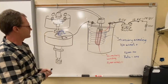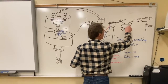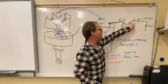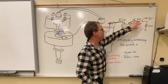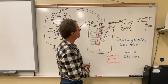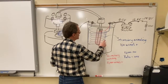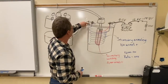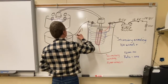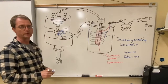When we turn the key on in our car, we send power from the battery through the ignition switch. On older cars, we had a special resistor called a ballast resistor that brought the voltage down from 12.6–14.8 volts — the range when the car was running — stepping it down to 9.5 volts. It would come into what we call a primary coil inside of the ignition coil and run through that primary wire up into the distributor to a little switch called the breaker points.